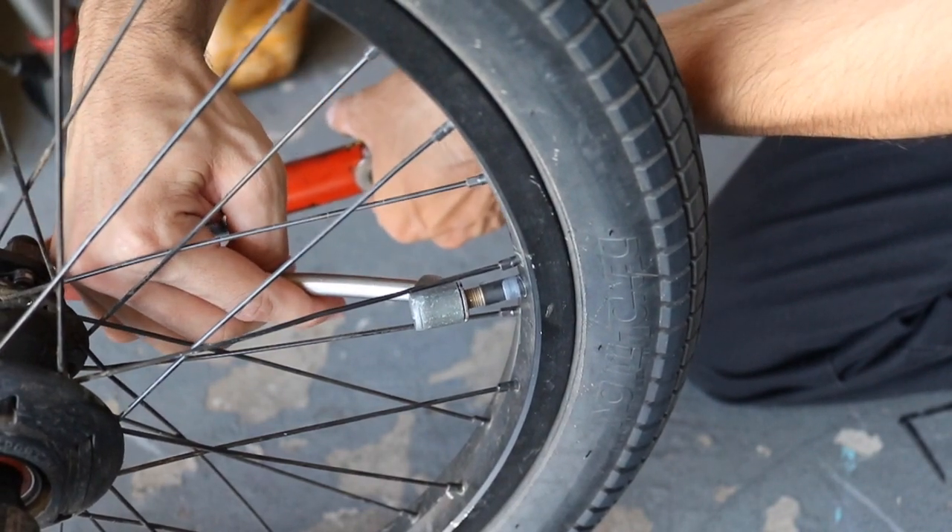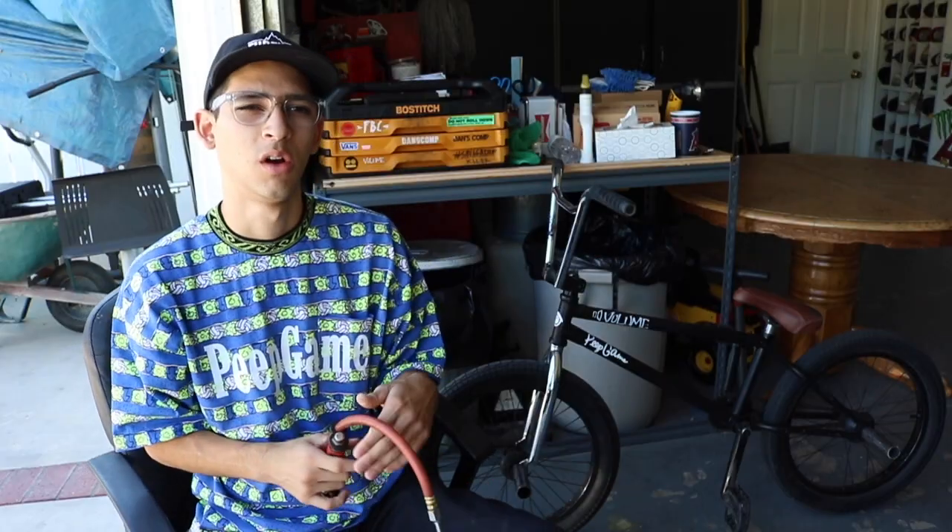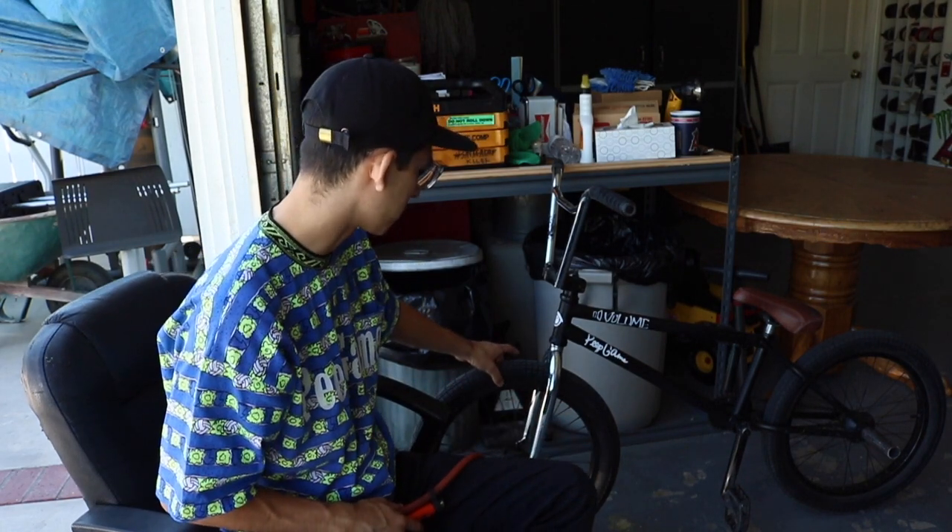Just hook up your pump, press it in, look at the dial — 60 PSI, 65 PSI, you're good to go. But don't over-pressurize your tire because tires have specific PSI limits. Some can go up to 150, some can only go to 50, so keep that in mind when you're pumping up your tire.